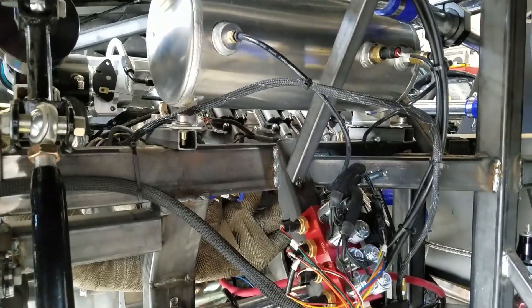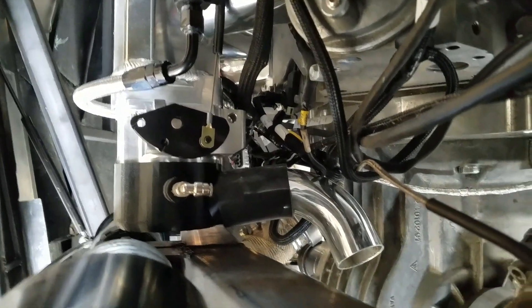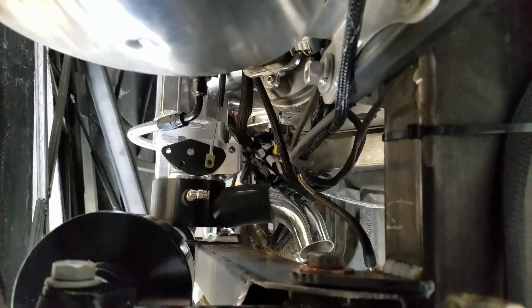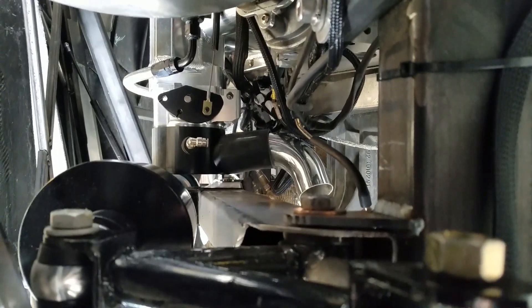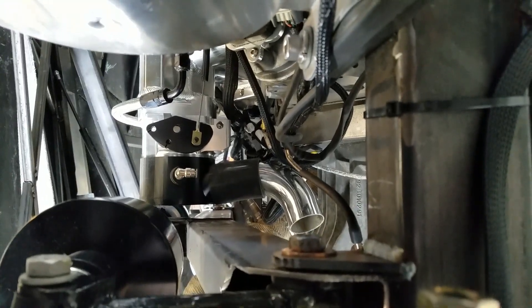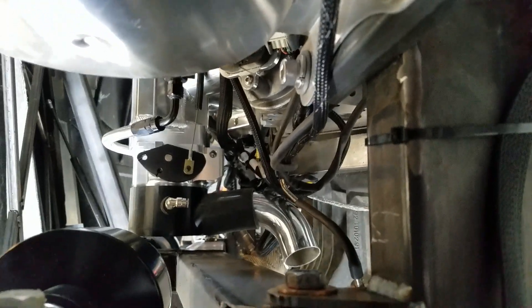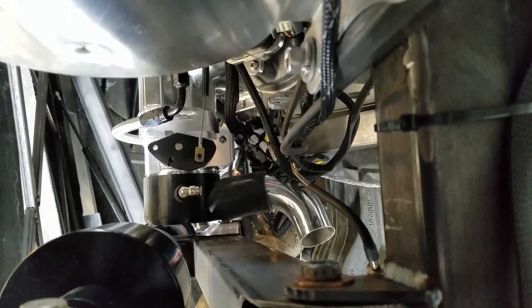We have our air system - I think I've gone over this before and shown how it works. We've put in a lot of our wiring harness and have our throttle cable set up. The next thing is I'm going to put the sensors in the intake manifold. The intake manifold requires a temperature sensor, and all the vacuum components are run off of that. The vacuum components are actually underneath the intake, so I've got to pull that off, weld a bung on there for the temperature sensor, and plumb up all of the vacuum lines.